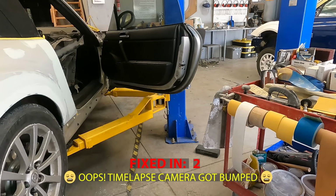We're gonna take the door latch out, the door handle, the mirror, and I'm actually gonna be taking out all of the wire harness. So you're gonna see me take off the little foot trim here and the trim up under the dash right here, and that's to get to the connector. I'll show you the connector at the end. It's kind of a pole style. It twists, and that is how it opens up to unlock. And once it's all the way back, you can pull the wire harness out and then unclip it from the outside of the car. It's relatively simple, but you'll see the overall process of pulling everything out. So let's get started.